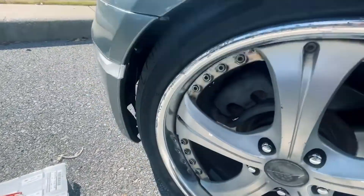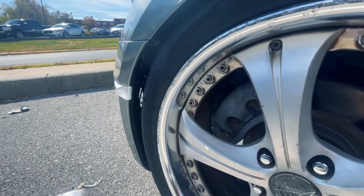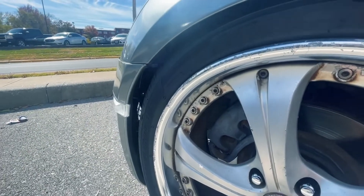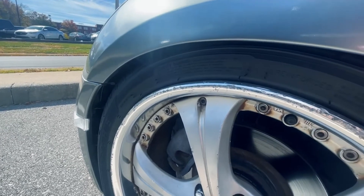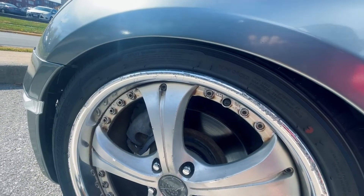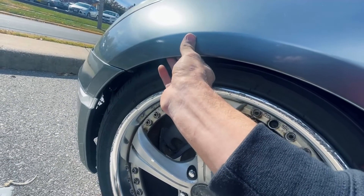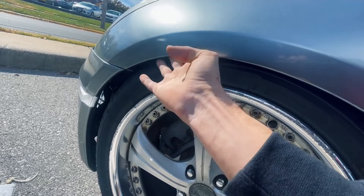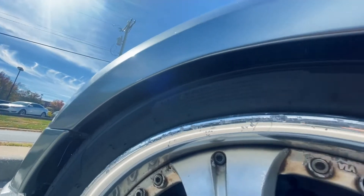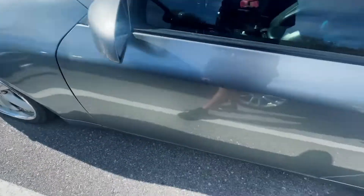I had to turn the wheel in on both sides to get space to unplug it. I don't have fender liner in right now because I'm slammed, so that helps the accessibility. After maxing out the front coilovers I can't go any lower on the front, and I only rub on one of the tabs for the fender liner right now. If that doesn't self-clearance I'm just gonna beat it in with a mallet because it's just the one little tab. Other than that, drives good — great car.